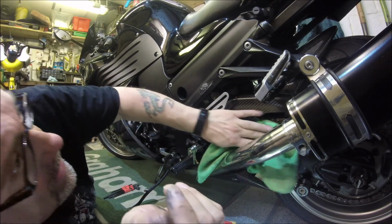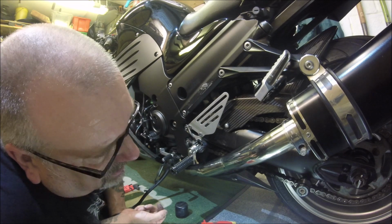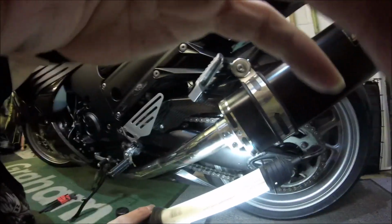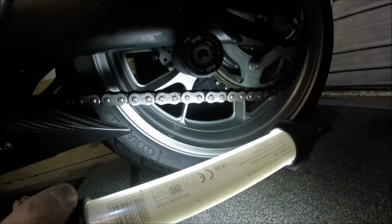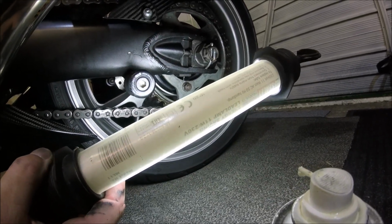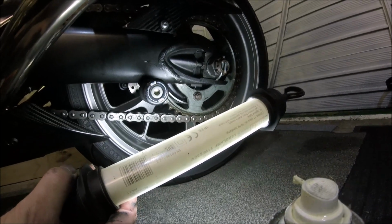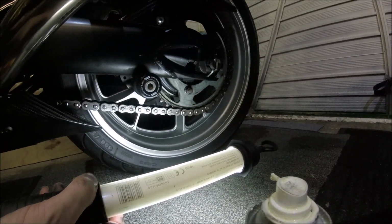That's a little worth keeping an eye on. Got a drip of something on there, or residue of a drip. Now it doesn't look like it's come off the chain, because the chain, I won't say it's dry, but I'd say it's not great. What's the sprockets like? Just turn you around a little bit. Bring you down here. So it is kind of oily, but I don't think that's chain lube. I suspect some lazy person probably sprayed something like WD-40 or gear oil or who knows what over that. But we'll give all that a good clean off when I give the bike its normal valet or valet, depending on how you want to pronounce it.